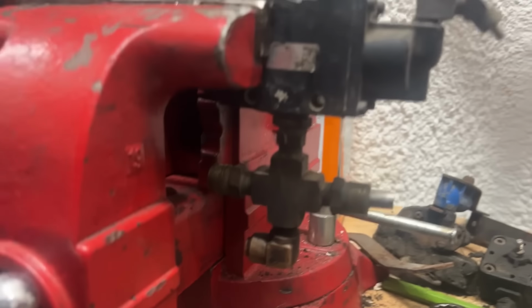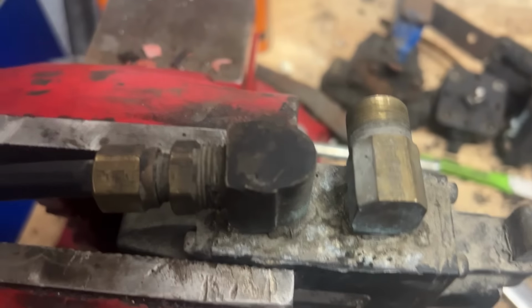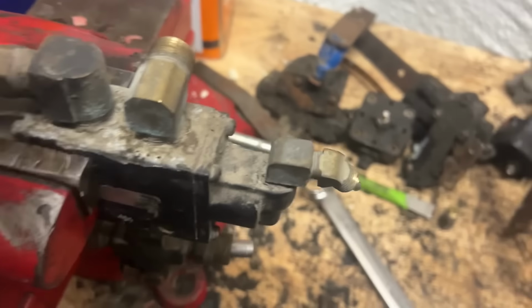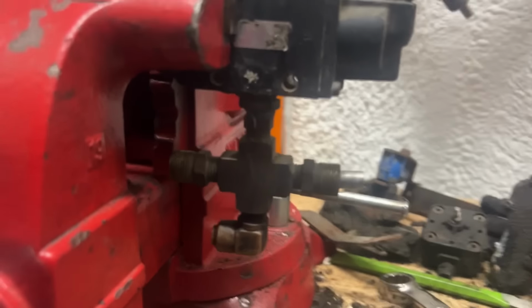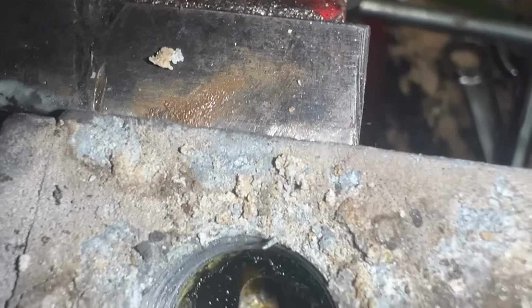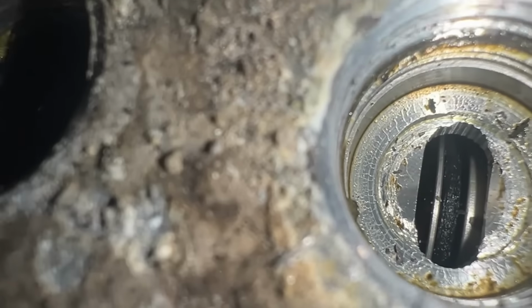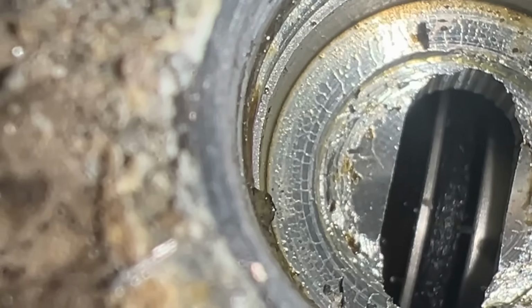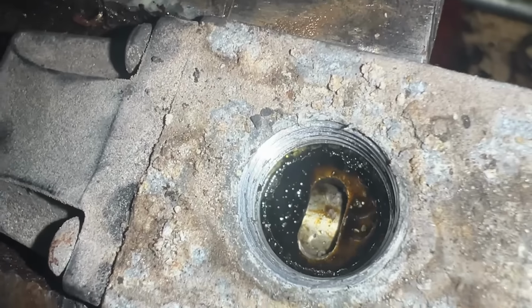Yeah, this valve's got enough crap running to it. You gotta take this out, spin this, and then that one will come. This one, I'm not even sure if I get, but you gotta take that out, and then that. The bottom one's the only easy one. Let's see how nasty it is down inside that Norgren valve. That O-ring looks terrible. I'm sure that's why it was leaking. Contamination and gook.